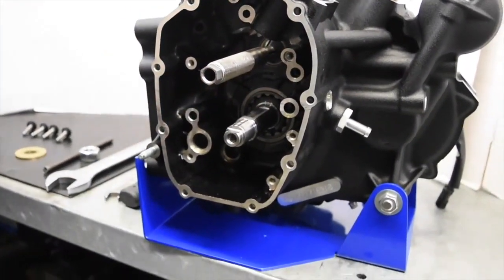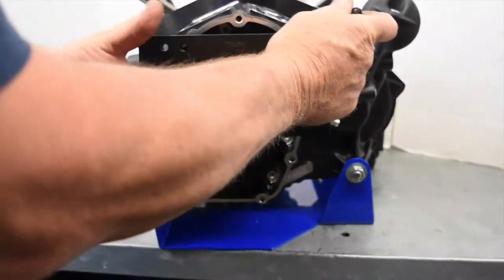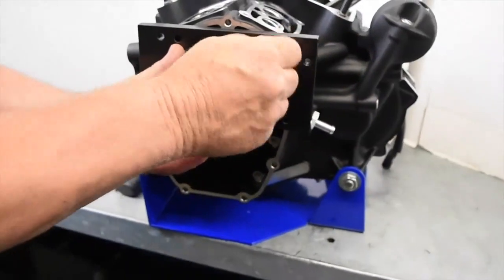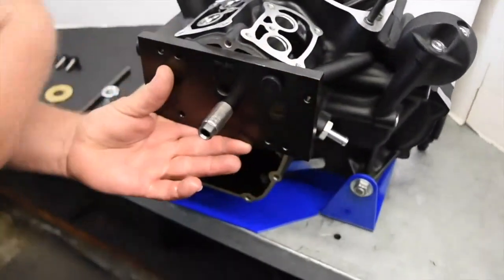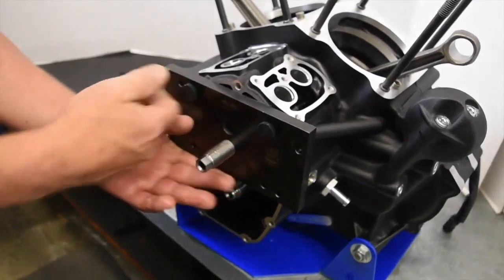Carefully place the puller plate over the cam chest with the engraved side out and the word remove towards the bottom. Line the unthreaded hole with the end of the puller and guide it through. Align the four holes marked with the letter R with the cam chest screw holes and install the four thumb screws, hand tight only.